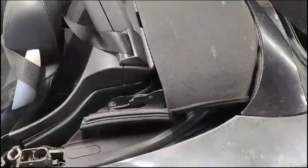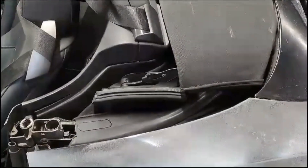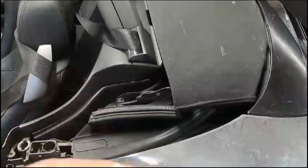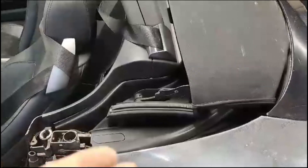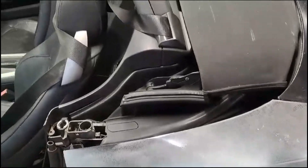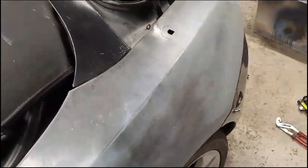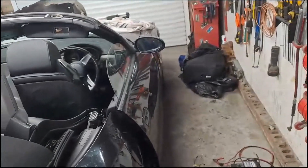The roof's got to come back off because it's still not working. The pump's running but the roof doesn't work. I think the release valve is stuck in a bit, so even when you take the cable off the valve's stuck. I've got to take it off, lube the valve up, and hopefully that frees it and resolves the problem. Then the roof's sorted and I can get on with the wrap. I also have suspension struts to do but looking at it I'm not sure whether I'll do them or might send them back.